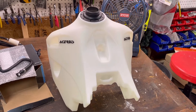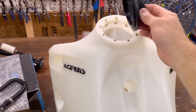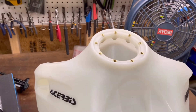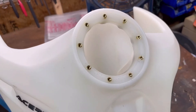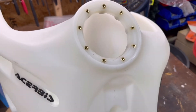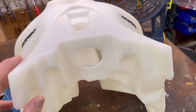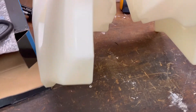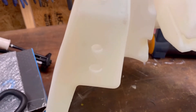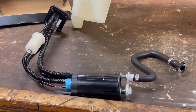This is the tank that the fuel pump is going to go into. I had to take the fill plate off to be able to reach inside. There were some shavings, so I wanted to take it out and clean it a little bit. I didn't want to put a brand new fuel pump in and have to replace the fuel filter in a couple of weeks or months. The fuel pump will be dropped here, and then the fuel line and the draining bolt will come out of the left side of the tank. Before the install you have to take out the fuel line and the draining bolt.